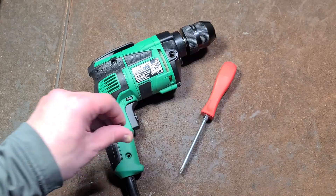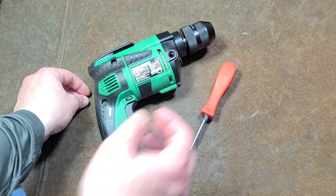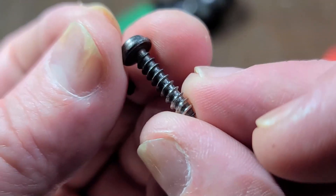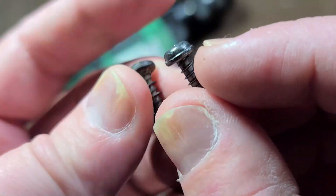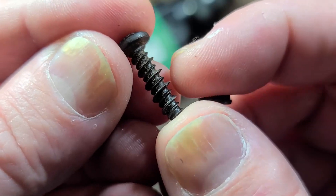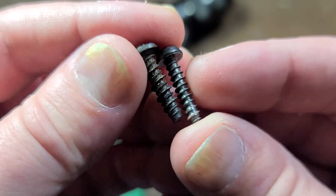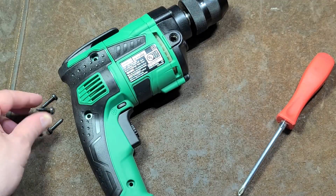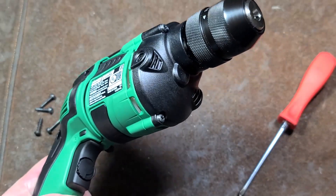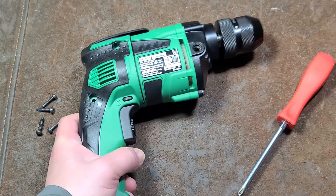Let's take a look inside. They are using cheaper fasteners — they're just Phillips only. I should also mention they're not torx, and they're standard plastic screws — they are not plastites. Plastite screws have a second set of threads that are extra long to get extra heavy-duty grip, but these are just standard ones. What that means is if you have one of these drills and you use it relatively often, you'll periodically want to recheck that the gearbox screws are staying tight.